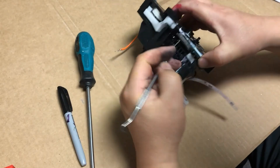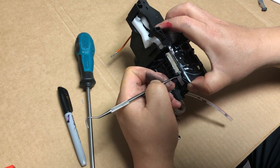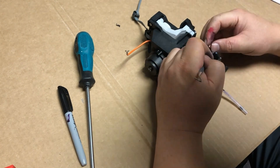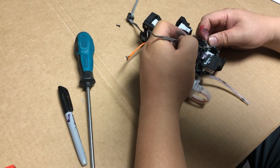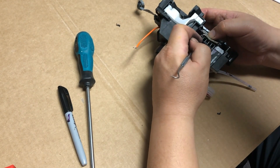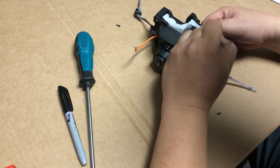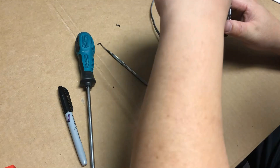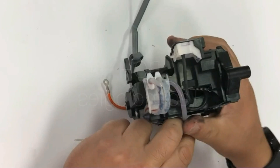This wiper — you can see there's lots of ink there. The wiper is used to wipe the bottom of the printhead, so if you have excessive ink it gets cleaned. This wiper, just like a windshield wiper, needs to be even. If you have dry ink like this, it cannot wipe the printhead clean and you also get streaks. So this is why sometimes you get streaks — it's not because the printhead is clogged, it's because this wiper is malfunctioning.